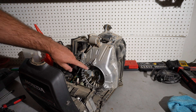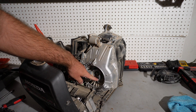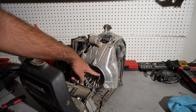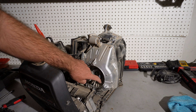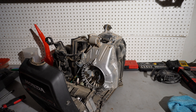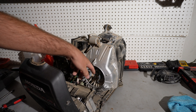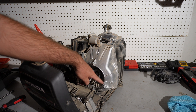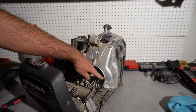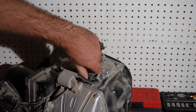These are the fins that get turned by the pull starter when you start your motor. You're going to want this piece of the fin lined up here, and then this piece that is flat right here lined up with the little arrow. If that isn't on top dead center when we take our valve cover off, we'll rotate it again and line up the other one, and that should give us top dead center. Now we're going to come up where the spark plug is and unplug it.